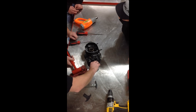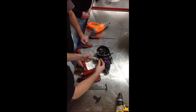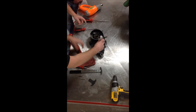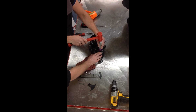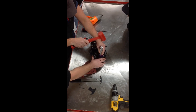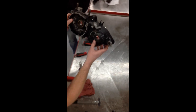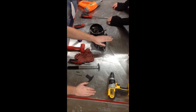Take your mallet and just kind of start getting it set. What this seal driver kit comes with is a handle you can thread through, but most of the time I don't use it — it's just in the kit just in case. Set it in there to raise your work area, and if you're off to one side, just move over and tap it down. Be really careful to make sure you're going flush — don't go over. Go ahead with a little bit harder taps. There you go — back to the middle because you're good and even. Feel around that edge with your finger and life is good — it's nice and flush. We'd always use a new seal and then decide what to do from there.